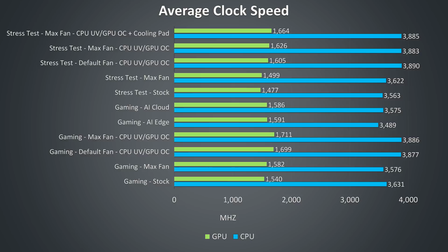With the stress tests running and laptop at stock, there was both thermal and power limit throttling. As we saw in the last graph, this test got the CPU to the hottest point of 96 degrees Celsius. However, the thermal throttling could be removed by maxing out the fan. The default 52 watt TDP was now being hit, resulting in power limit throttling.